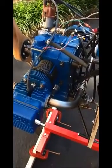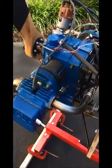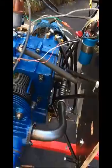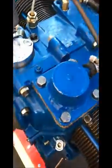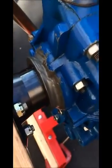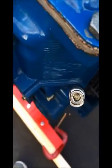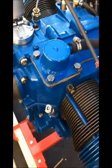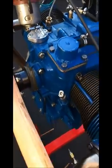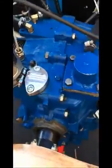It's got the same prop on it. Incidentally, this is a 54 by 22 pitch prop, which is wood, of course — you have to run these with Volkswagen because they've got a relatively weak crank. You can see the seal is JB welded on because there is no seal for this in a regular Volkswagen. So that's a modification I'm probably going to look into making, along with an external oil filter. Interestingly, these engines as designed never had an oil filter until the late 70s when production took over in Mexico.